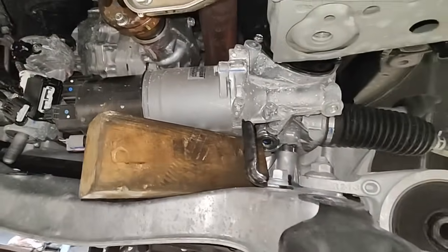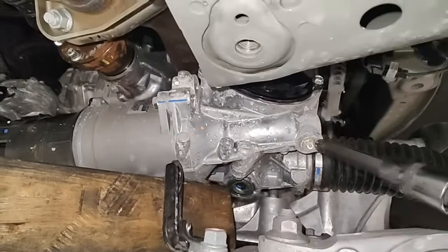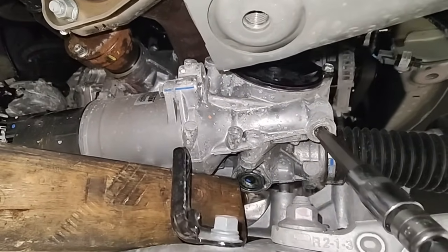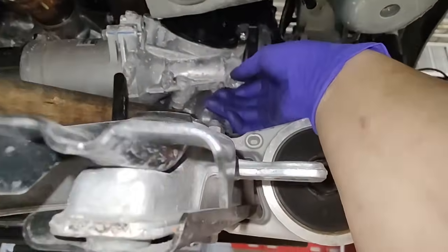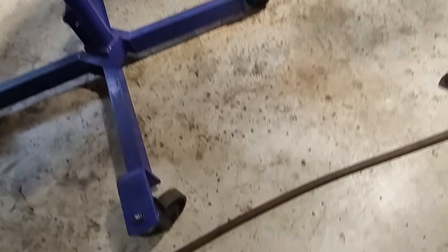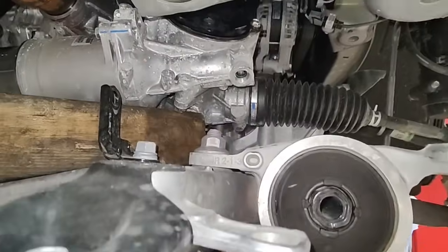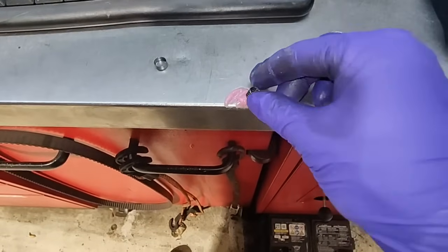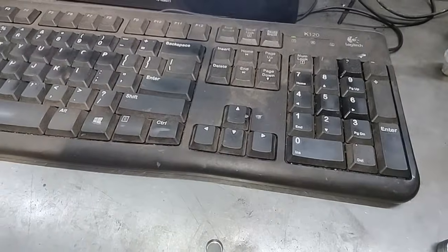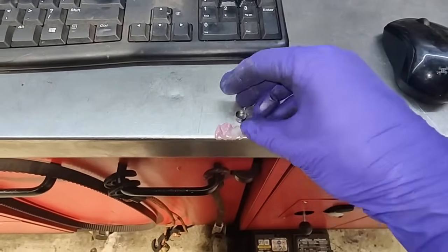Steering rack is off - I stuck the piece of wood like I said. The bulletin says it's an Allen but it's actually a triple square. Using a wobbly extension to get in there - pull the plug. There's a spring and a little thing in there - dropped it - there's the little spring. Throw the old one in the garbage, put the new one in with that extra grease to hold it in place.